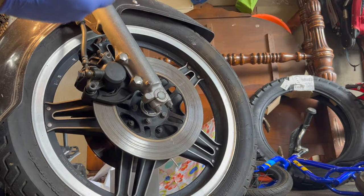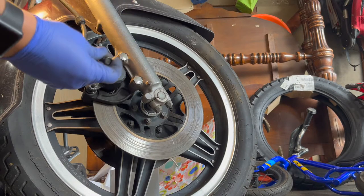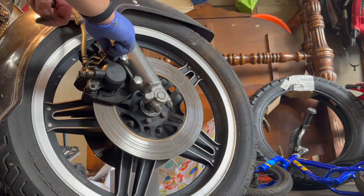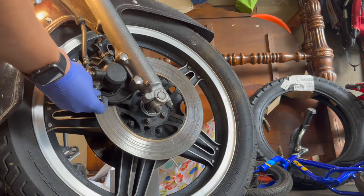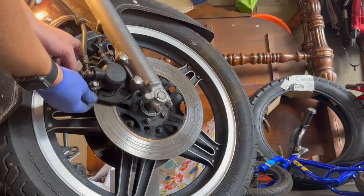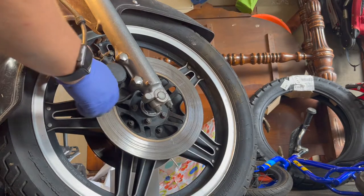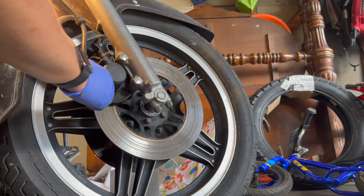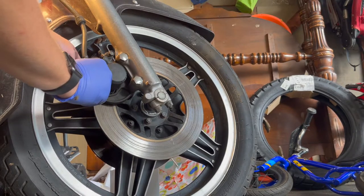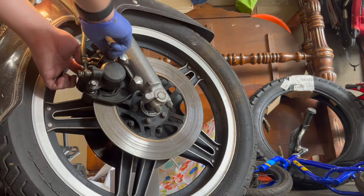These bolts are pretty good. These are 12 millimeter, so I took them off with a half and started rounding it a little bit, so just be careful that you use the proper one. I went and got a 12 millimeter and that worked out way better because it's the right size. Imagine that. Always start these by hand because I don't want to ever risk stripping these out.